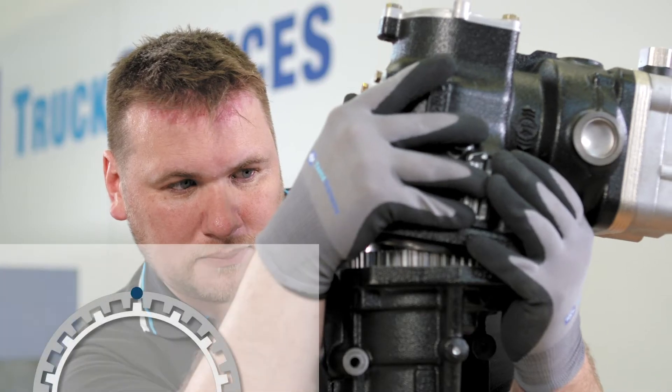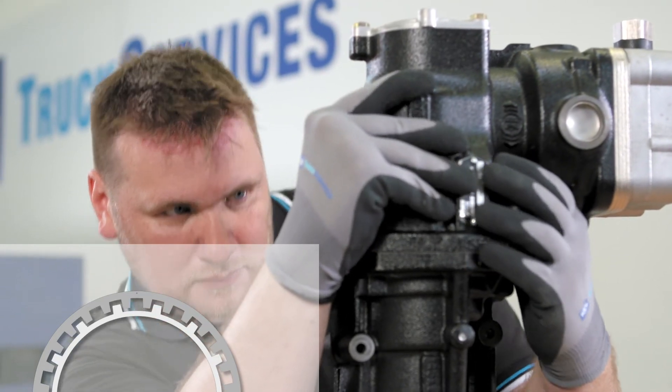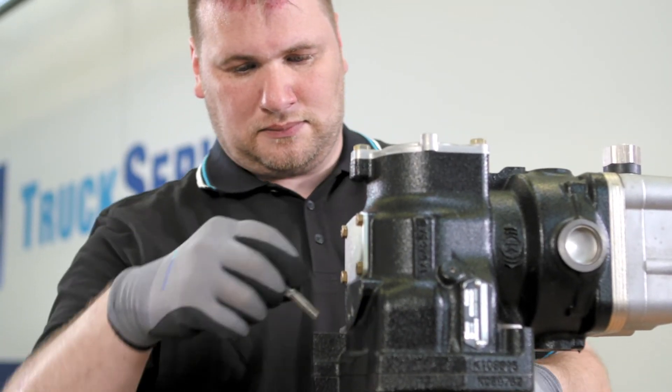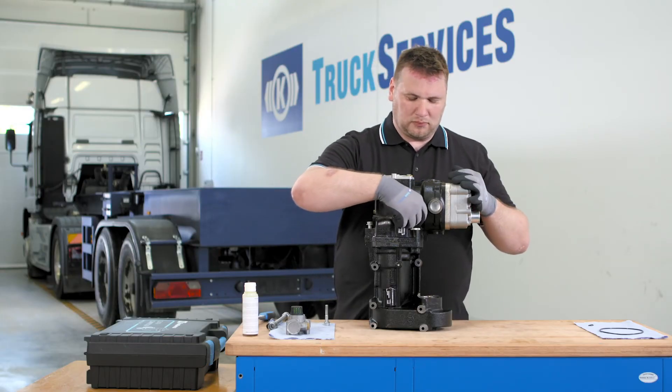Take care to ensure that the teeth of the plates are inserted into the unmarked position on the clutch bell teeth. Place the compressor in position without rotating it and keeping it as upright as possible in order not to shift the o-ring out of position.